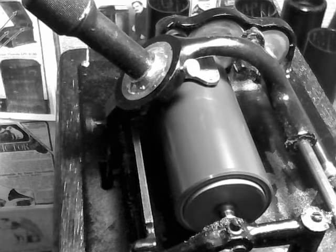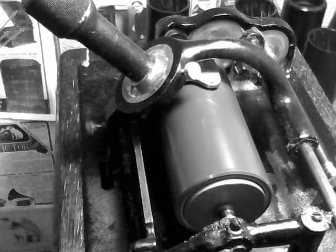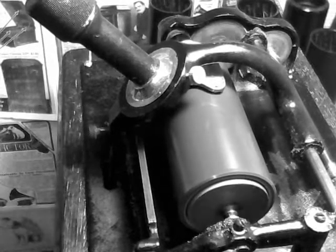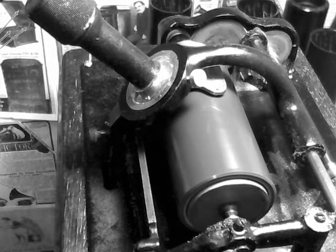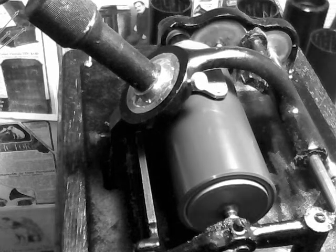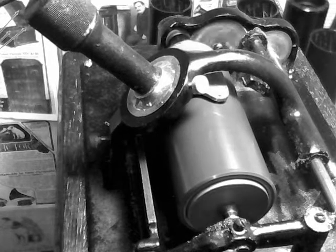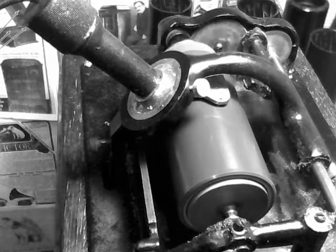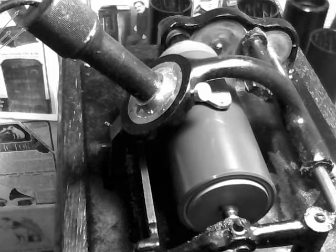In the meantime, I've got the machine readjusted. I wanted to point out one thing. I've gotten a lot of email about erratic speeds on machines. If you're recording on your Edison Cylinder phonograph, you have to watch out. The swarf gets into every single moving part on the Edison phonograph, especially the topside gears, the carriage itself, and the transport rod.